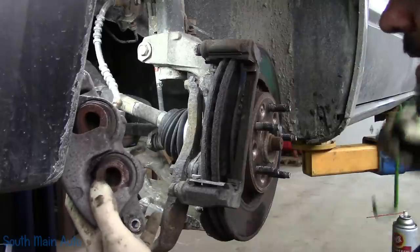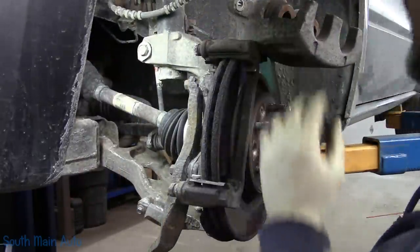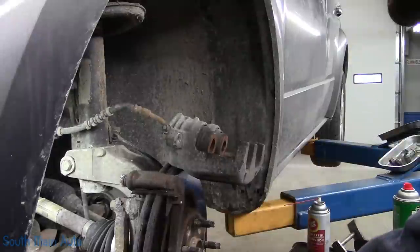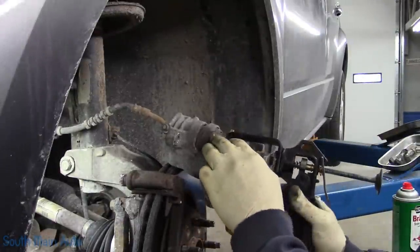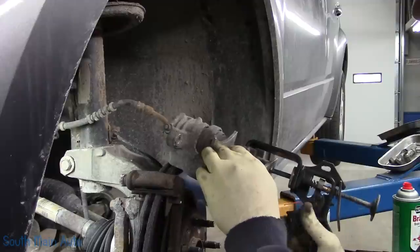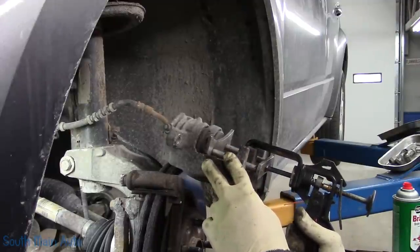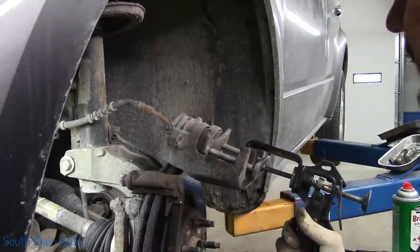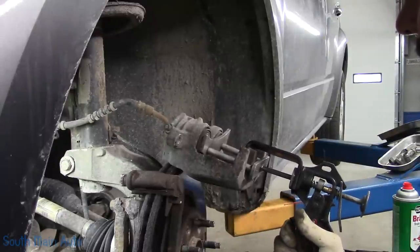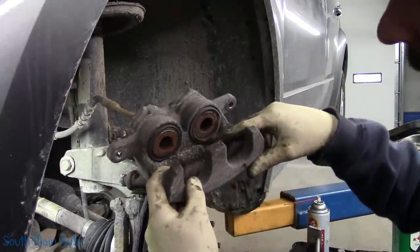We'll hang this baby on a hook. After we push the pistons back in here, we'll make sure this caliper's good before we get too far. We will be using our double donger piston pushback tool — link's going to be in the description for the majority of the tools used here. We just want to make sure those pistons move in nice and freely. You can use a couple of C-clamps if you've got them. Alright, so they're pushed in.